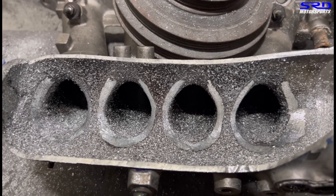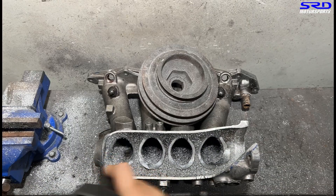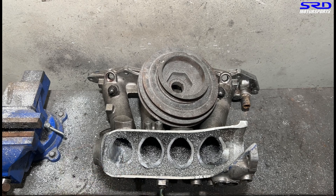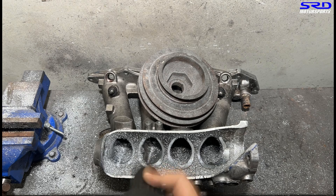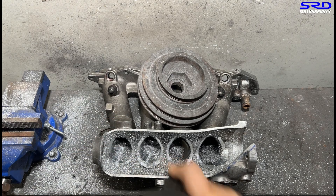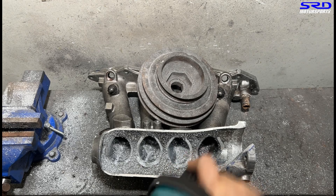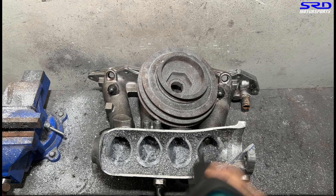Starting the opening up. Now we continue for the rest of the runners. We're going to port like the first two or three inches into the runner so that we can get a consistent taper. Later we're going to show you how we get it all consistent with the cross-sectional area — the opening of each runner. We'll show you that later.